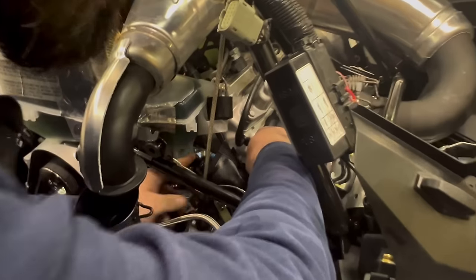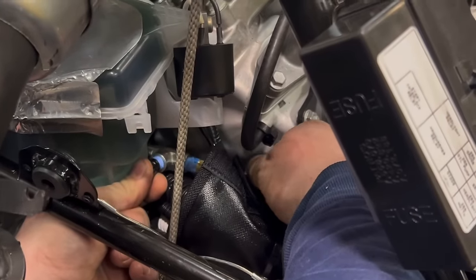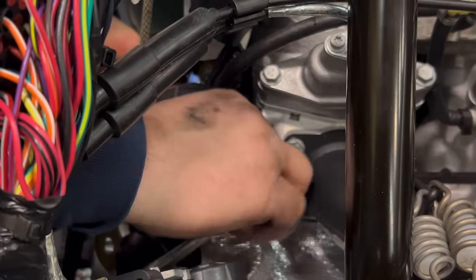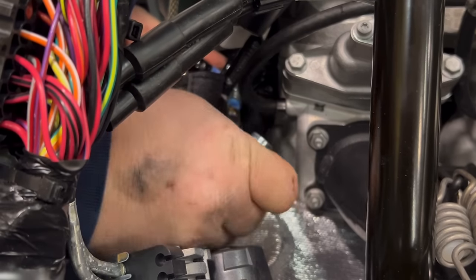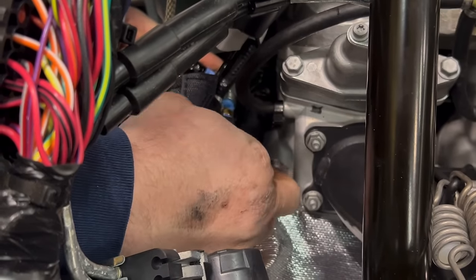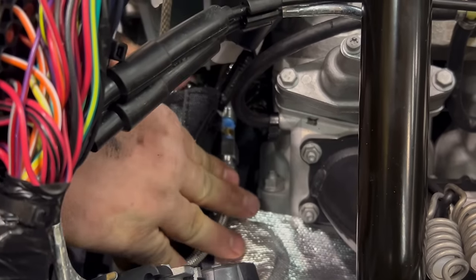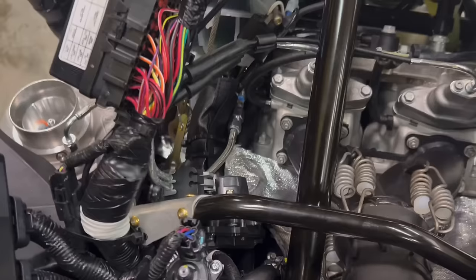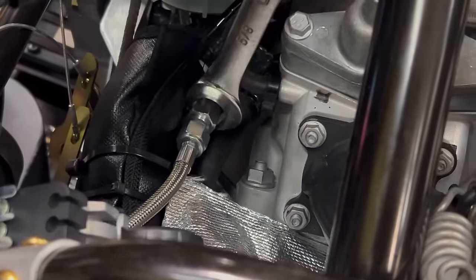Now, wrap the oil line up and connect it to the regulator. Sometimes it's better to run it under the electrical, sometimes over. We have noticed a serious inconsistency in these. Now taking a 9/16 and a 5/8 end wrench, tighten up the oil line.